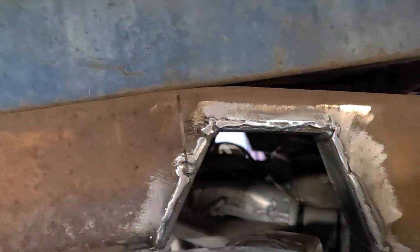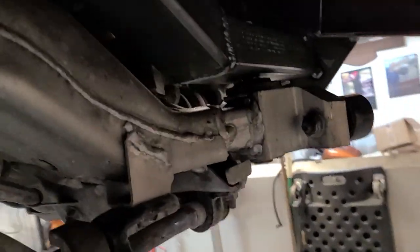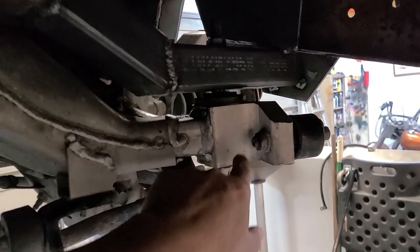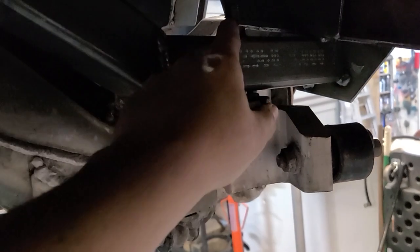The big progress for today is the rear end is in. So we've got our boxing plates on the ends. Got our frame notched for our upper control arm so when it swings up. The front crossmember is 2x3 steel. We used a 5/8 inch gas pipe for a spacer between the factory bushings. 5/8 inch bolt welded on top of there. Boxed the inside of the frame on both sides.